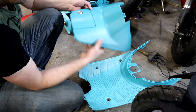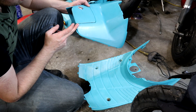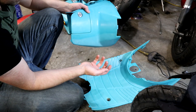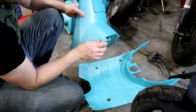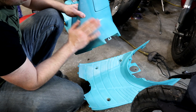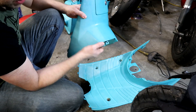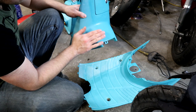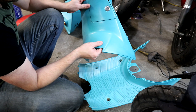It works really well. I did this line here as a definitive line to see the difference between the two — this is not heat gun, and this is heat gun, and obviously this side is a lot more vibrant. Basically what you're doing is this is oxidized or sun-weathered plastic. The UV has broken down the plastic, and when you heat that up with the heat gun it melts the top surface and, because this is opaque, it dulls the color. So when you melt that back in and make it clear again, the color gets vibrant and pops back out.